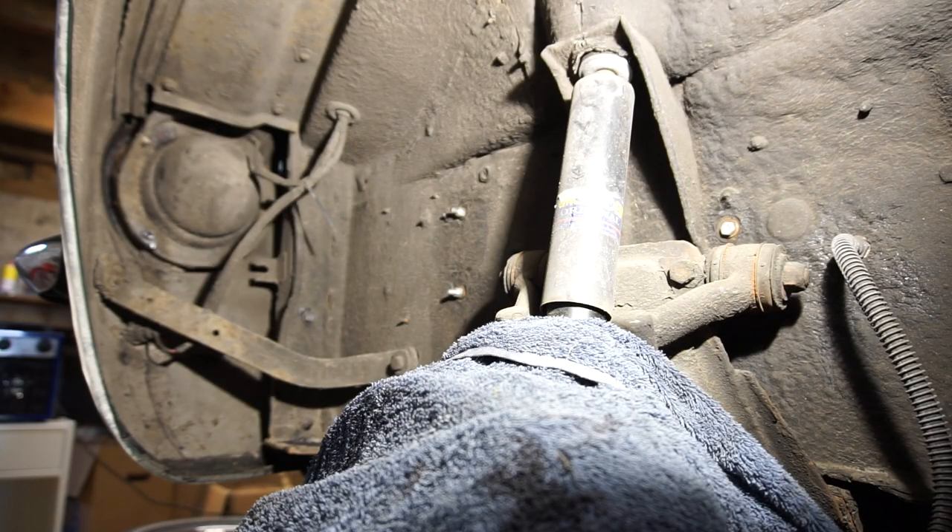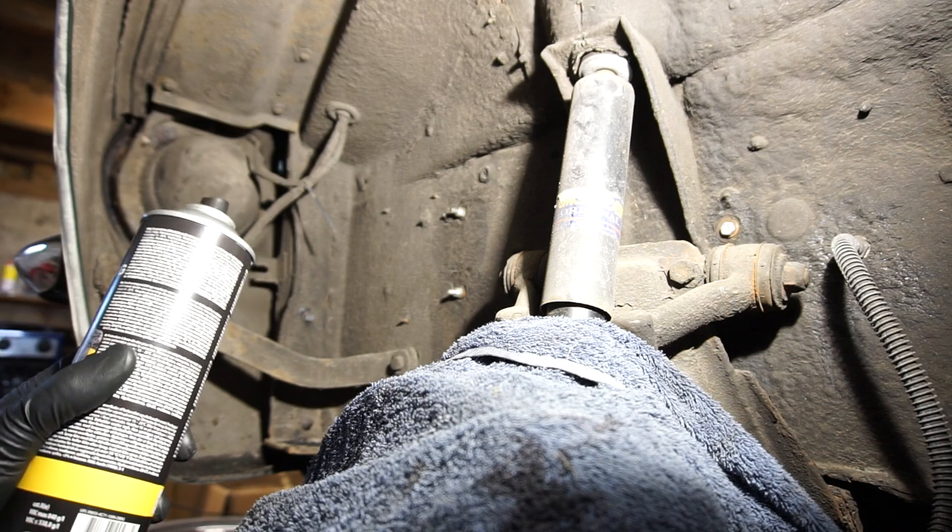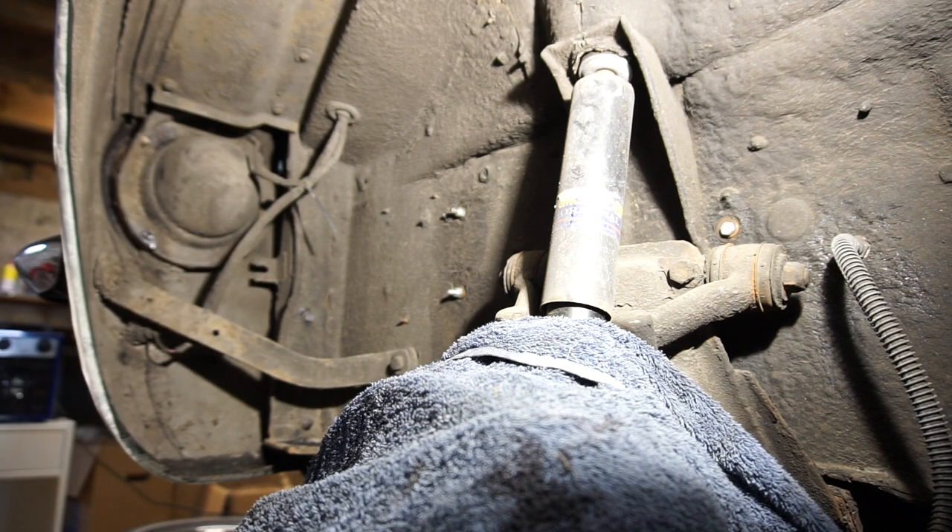The wheel arches are in very nice shape on this car — none of the paint has been worn off — but I want to keep it that way. I've set up a different light and camera so you can see it really well without me getting any of the stuff on the camera. If I sound a bit funny it's because I'm wearing a respirator, and if you hear other noises, the door is open for ventilation. I've mixed the can for quite a while so it should be good to go. You need a fairly warm environment — between 15 and 25 degrees — it's about 17°C in here. I'm going to start by spraying all the areas that were bare metal that I treated.